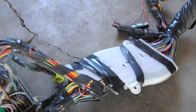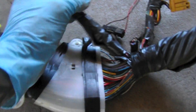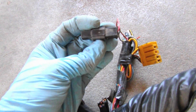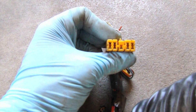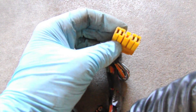Those are two pretty important things to keep. It goes into this giant plastic housing that keeps things neat behind the Legacy dash — we're going to get rid of that. A little further here is another diagnostic connector where you can read old codes stored in the computer, and then we have the select monitor connection. I like to keep this because there's a great program called the B10 scan tool — a very entrepreneurial young guy put that together and it's awesome — so we're going to keep those on these conversions.